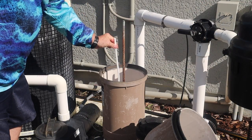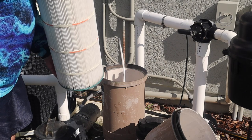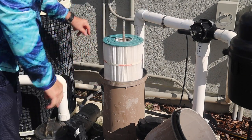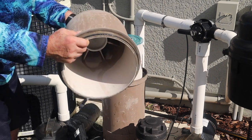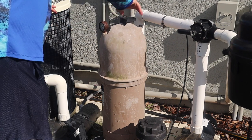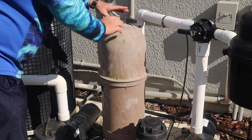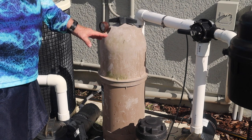To put it back in, tighten that up and make sure the screw is in the middle — you don't want it flopped over because it's got to go down the middle of the housing. Line it up, put it over the top, wiggle it a little to make sure it's all the way down, and make sure that white dome is in there. Wiggle it on as you're turning it and pushing it down — at some point you'll feel it grab the threads and it screws itself in tight. There's an air release here — I always loosen it when taking that off because it makes it easier to get off after putting it on.